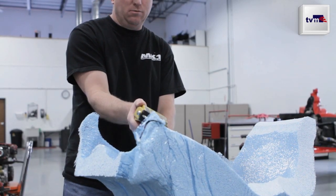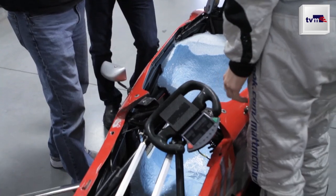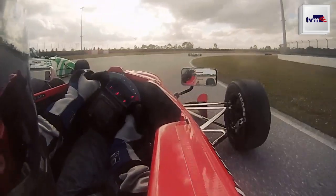There's science behind the size of the beads, the type of foam used, and how thick the seats are once they're poured. By doing a custom seat you can make the body relax because you design a seat that from below the knees all the way up to the shoulders provides support. In a regular sports car you'd be slinging around trying to hold on, spending half your energy on the steering wheel. But in a race car the driver sits in a pocket with support up to the shoulders and knees. Whether it's a front, rear, or side collision, forces are evenly distributed, giving a big safety advantage and a huge performance advantage because the body can relax and you can focus on the driving.